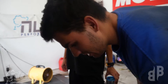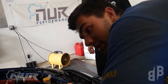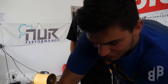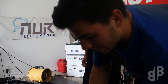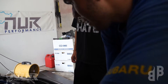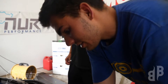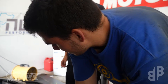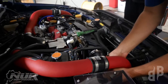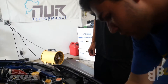We think it might be the TGVs being funky on us. What we're going to do is reset the TGVs by unplugging them — unplugging the piggybacks which power the fuel pressure sensor and the E85 kit — and re-plug in the original plugs into the TGVs so the computer can recognize them and maybe reset them. Something funky may have happened when the TGVs weren't plugged in and the car got turned on, so we need to plug them back in and let the car recognize itself.